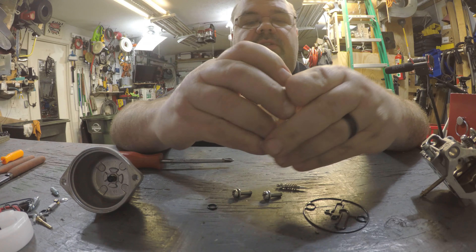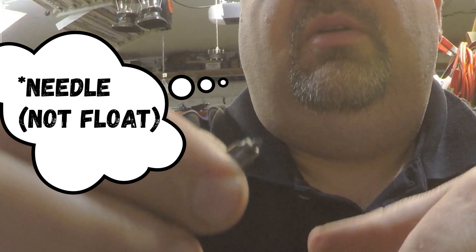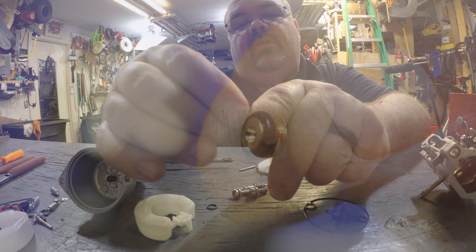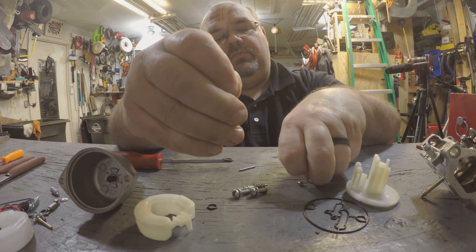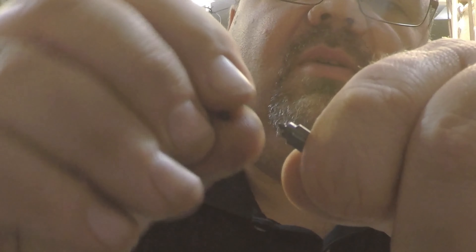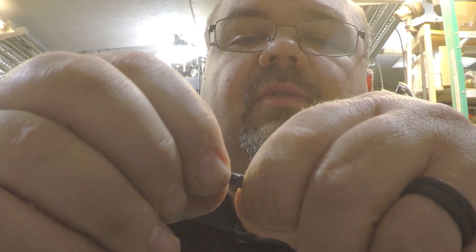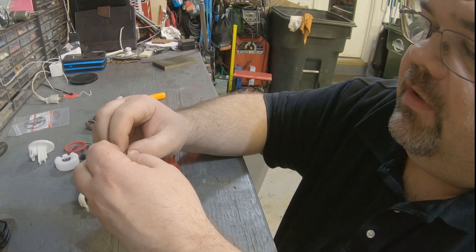Next, pull this pin out. As I showed in the previous video, this float doesn't have the rubber tip on it. Your main jet o-ring can also go bad and cause it to surge, because it'll suck excess fuel up into the motor. This is what happened with this particular carburetor — you can see the tip has come apart. The tip is still very pliable and feels in good condition; I'm not sure why it came off.